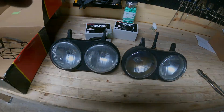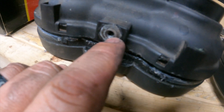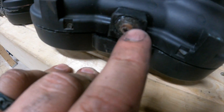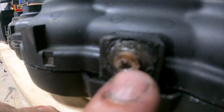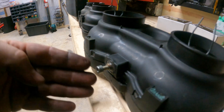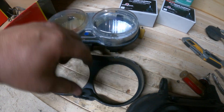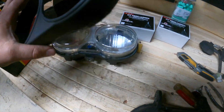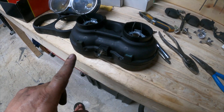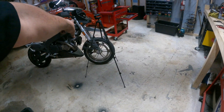Let's pull this apart and take a look at the new bulbs. It's been a couple of minutes and I think I realized why this was on eBay. This little plastic housing for the metal nut came clean off the old one. On the new one, it spins, the bolt is stuck, and the head was ruined, so I cut the head and drilled and tapped it for a tiny M5 — all it really does is hold some forward motion. I tried to pry the housings apart and the best I can tell they glued it, snapped it on, and squeezed it together. There's no way that's coming out without destroying it, and it was the only one on eBay listed for an XB12X, so I want to preserve it. I'll use washers and whatever to get enough tension through the fender to keep it from swinging.